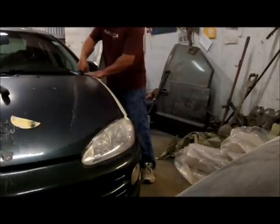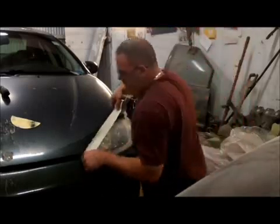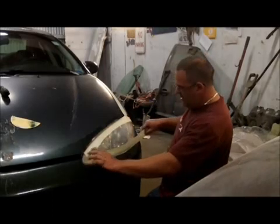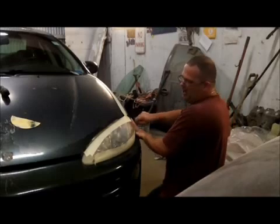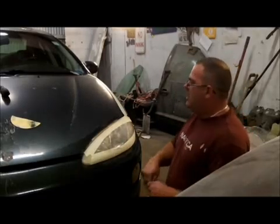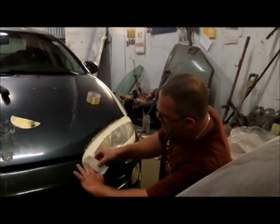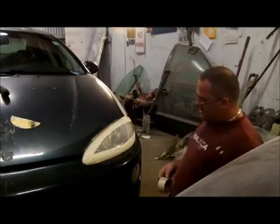I've learned my lesson over the years, guys. You have a panel that's peeling. You go and mask it off. You go to pull the paper off when you're all done painting, and the panel that you put the tape on is peeling. Then what happens? Now that you've put everything away, you're all done with your job, now you've got to spray the panel for free, when you could have just made it a blend panel and been done with it. Okay? So we've got enough tape on here now to protect some stuff.